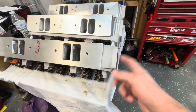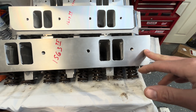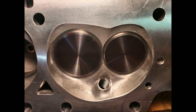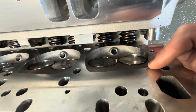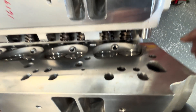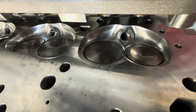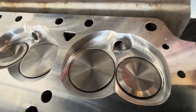The E-Street head comes with flat tappet springs — it's a cheaper model and I think they have powdered metal seats. You can get these in a 75 CC chamber. I've got that in my race car right now with a solid roller cam and 550 pounds of spring pressure, and they've been doing great. Rough casting on the chambers versus the CNC-chambered Trick Flows. But I'm pretty sure the chambers are identical on the 240 and 270 — they look very similar to me.